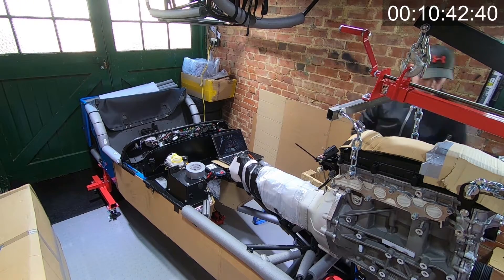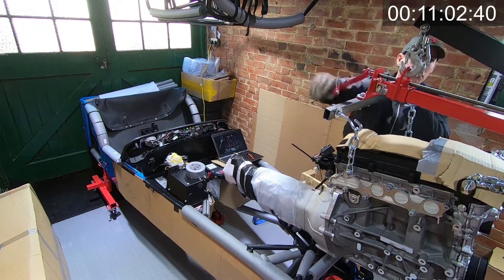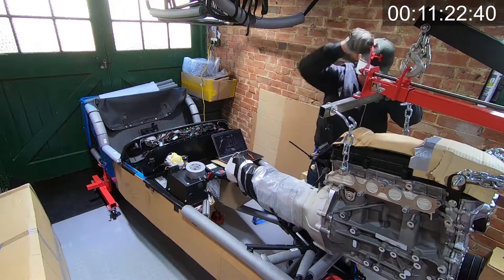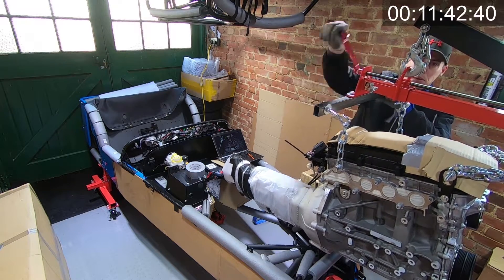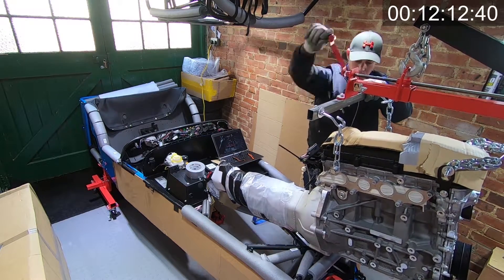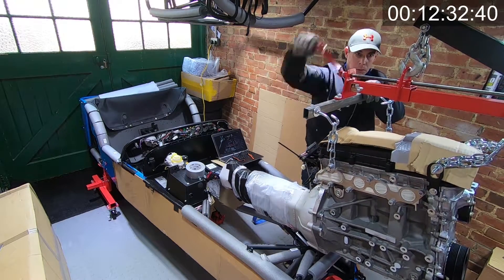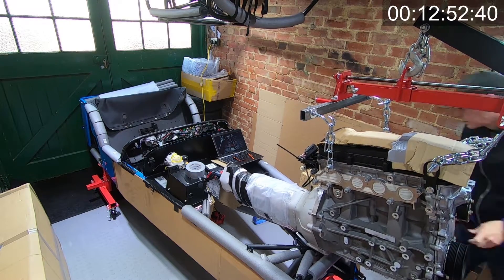In the previous episode during engine preparation, I had used some hose to protect the top front chassis rails, but these didn't cover the full length of the rails. I found during the initial part of the installation the gearbox did drop and knock on the star section of the top chassis rails, which were unprotected. If I were to do this again, I'd use one long piece and not two separate pieces of hose. Fortunately it did not make any marks, and I just added some duct tape just in case.